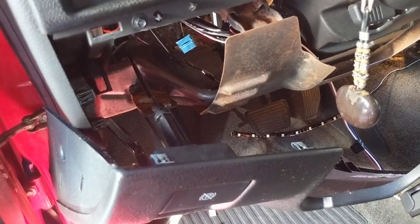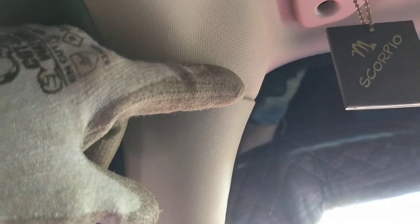One thing I also want to note: if it soaks really bad, you'll want to pull this panel off right here, because right up under your headliner there's a piece of like sponge, and you'll want to take your shop-vac or something and soak the water out of that.